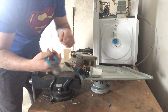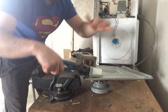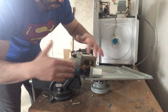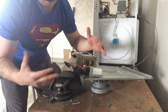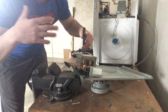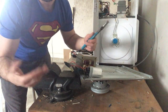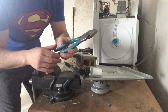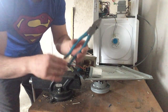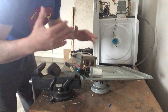Because the pliers are rubber, I'm just going to touch the two leads together. There is no spark — there is no charge. I think because I left this for a week and a half, there really is no more charge left, but I definitely don't want to take the chance. I'll get people commenting saying you should have rubber gloves on, and that wouldn't hurt — but definitely make sure your pliers or needle nose pliers do have rubberized handles. I have handled capacitors hundreds of times and never had a shock, but I don't want today to be the first.